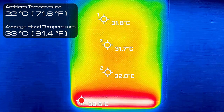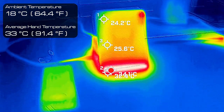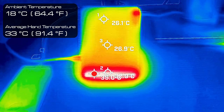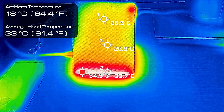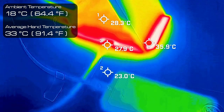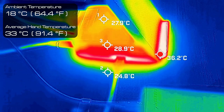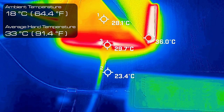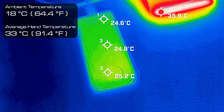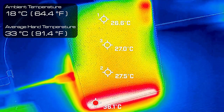You can see the front of it is very easy to touch. The HD22Q dock has been transferring data for probably about the last 10 minutes from this Thunderbolt 3 external hard drive. The front end is about 27 degrees Celsius at the top and about 35 degrees on the very bottom. Looking at the back end during data transfers, we're probably around 29 degrees on the top surface and about 30 degrees where the power connector is. We are in quite a cool temperature at the moment, around about 18 degrees Celsius here.